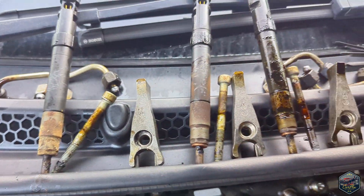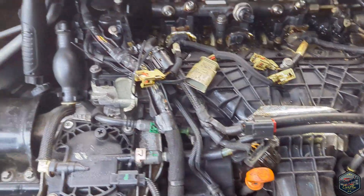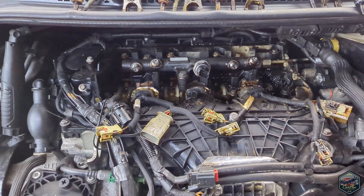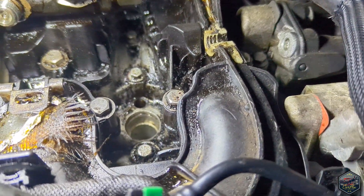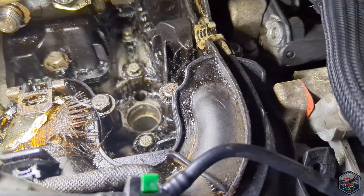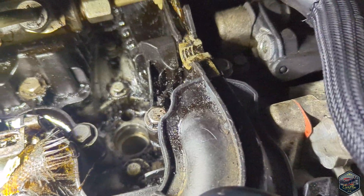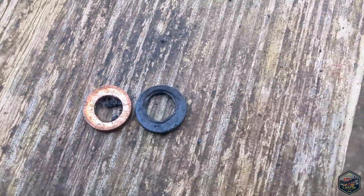I'm going to start by cleaning all the injectors — you can see they're all pretty dirty — and then once I've cleaned them I'll put the new seals on and put them all back in. I've zip-tied everything up so nothing's impeding me. The best method for getting rid of this stuff without wasting three cans of carb cleaner is to get a rag soaked with carb cleaner, jam it into every crevice with a screwdriver, leave it for about 20 minutes, and it'll loosen everything without risking dropping any of it down into the cylinder. I've slid the new seal on and it fits perfectly — no movement at all.